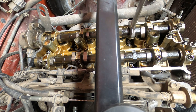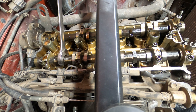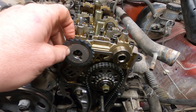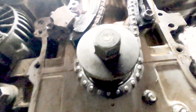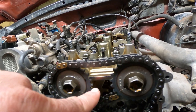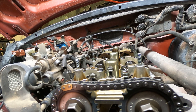This looks like it'll be much better now. My arrow is at the top so I'll be able to align the colored chain link with that arrow. Your cam lobes should be in this position pointing up. I've got all the timing marks lined up and both chains on. On the crankshaft you can see the two dots line up and the keyway lines up with that line. Then you've got the two timing mark lines that line up with the two reference pieces on the engine, and the arrows line up with the colored blue links on the chain.